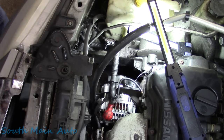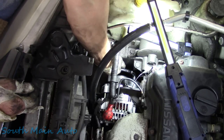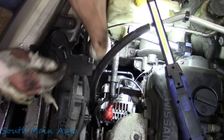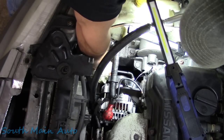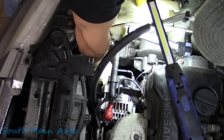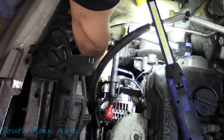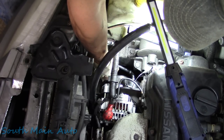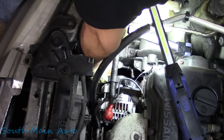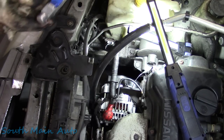And then what we'll do is I'm gonna reach down because this pulley might actually straighten up a little bit as I tighten it and actually add a little more tension. So I'm just gonna tighten that up. Then we can double check the deflection on the belt. Because you don't wanna just go by your gut. I mean, I suppose you can. But you definitely could shorten the bearing life of, well, everything on the serpentine belt.